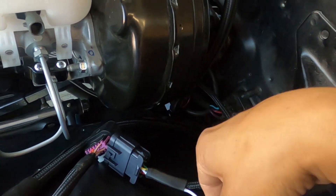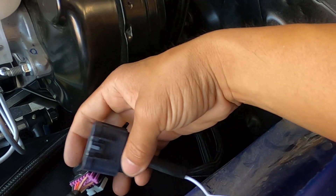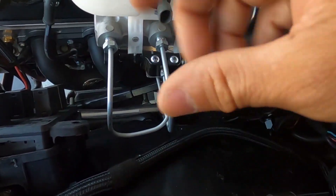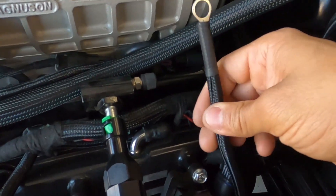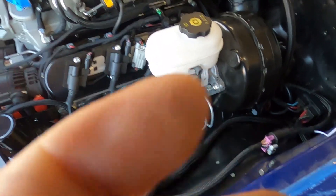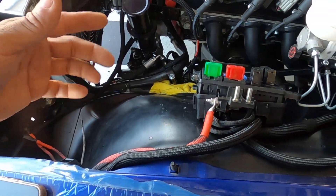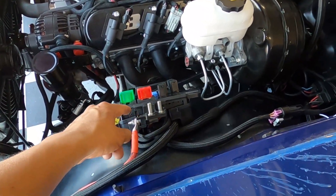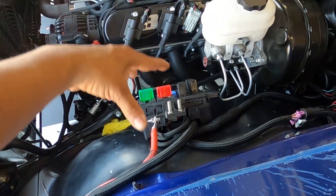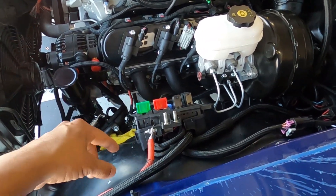I went ahead and put the connector on — connectors are ready to go. We also have the piggyback wire for the tach signal to the fuel pump control module, which we'll cover in the next video. We'll click that connector in there and leave it for now. For the ground wire, I put a nice connector on that — it'll go to the back of the cylinder head. That's pretty much it for the GM harness and transmission control wiring. Don't forget to still wire up your fuel pump wire and your fans — those are pretty self-explanatory and quick. I do not advise adding relays inside the fuse box — just piggyback off and run a separate relay outside.